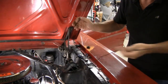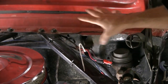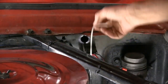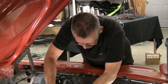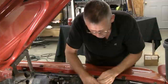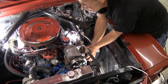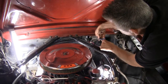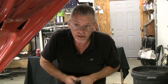This is the only wire that actually goes to the engine compartment — everything else is done under the dash. This is going to go to the negative side of the coil and plug into the harness. We found a hole here where somebody already removed a neutral safety switch that was hacked out, and the zip tie monster has got a hold of it in a few places. I'll get snips and clean some of this up. We take our wire, find a neat way to route it, use a simple 3/8 wrench to get the coil connection loose and connect it up. What looks nice about this whole setup is if you're building a car to look factory original, this would really be nice.